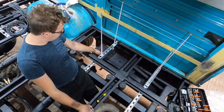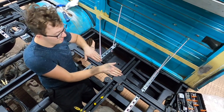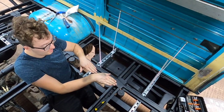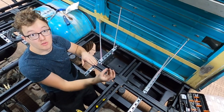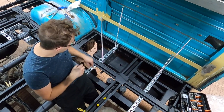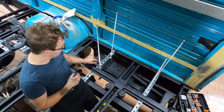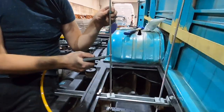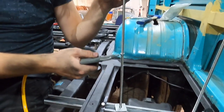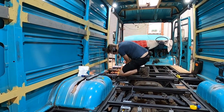We've just spent a while leveling off the tank — adjusting the bolts along the threaded bar to get the tank horizontally and vertically aligned with the van where we want it level-wise, draining to one end so when we're draining out it collects in one end. We're now going to put bolts down at the bottom on top of the plate to lock it in place, and then these threaded bars can be chopped off. This is lazy engineering.